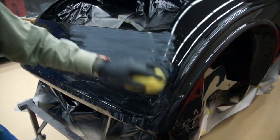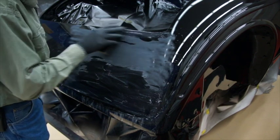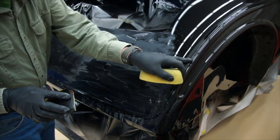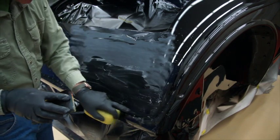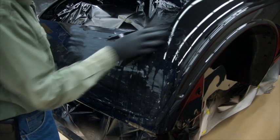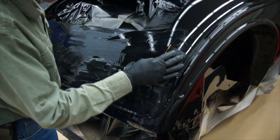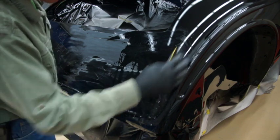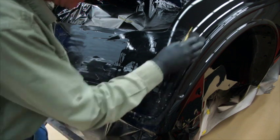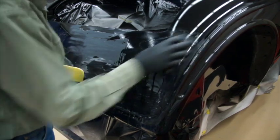You've got to be real careful on your edges — you've got to level that out, but on an edge you usually have about half the amount of paint that you do down in a crevice, where you have double the amount of paint due to the capillary action of liquid. Look at paint jobs where guys sanded and didn't get down in these corners real good — it looks pretty good until you get up to about here, then down that corner it looks bad. So you've got to be real careful not to get up on your belt molding, but you've got to get down in that corner and get it leveled out everywhere. That's just a lot of time.